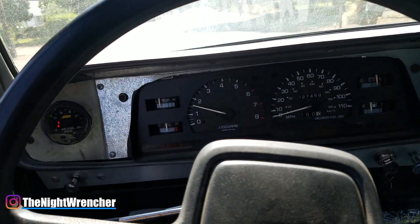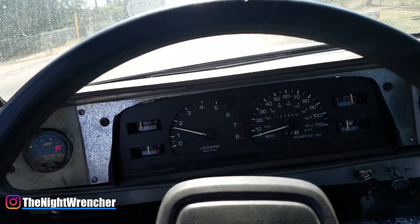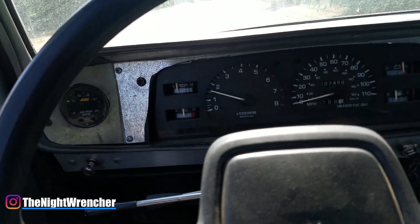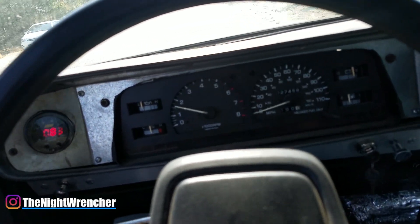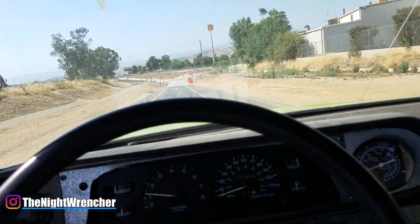Out on the road in third gear, barely into the throttle — in the IFRs or transfer slot, light load, light throttle. My AFR is hovering in the high 10s to low 11s, which tells me my IFRs are too big. The jets in it right now are 71s; I'm probably going to drop them to 69s. I'll set up the idle at the very end, because every time you change the IFRs it changes the ratio of the idle screws, so I won't touch idle until last.